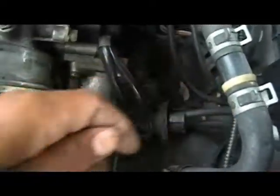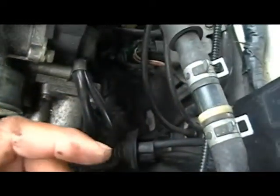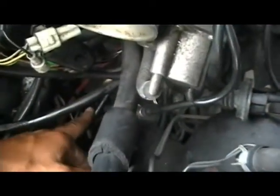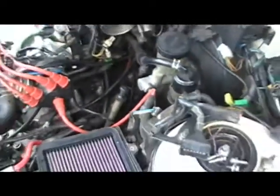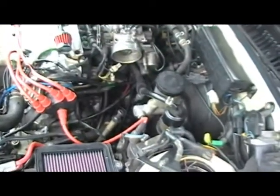This cable pops right out. Then as you take out the speed sensor from the inside, you've got to push the cable inward, because the cable is what's holding it in — it's not a long cable. You have to push the cable inward and then pop it from the back of the speedometer so the cable can hang there. You have to take it apart down there so you can push it up, because it's a very short cable.